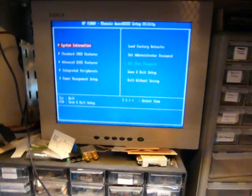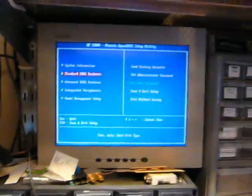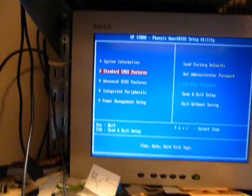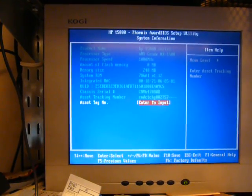And the password's gone. Yes. Just goes to show you how useless those BIOS passwords are. It takes someone just a couple minutes to get rid of the battery or find the clear jumper. Not very useful unless you have a hardware lock on your case. But anyways, there you go.